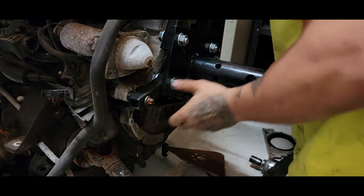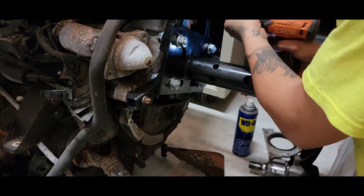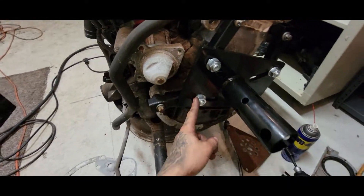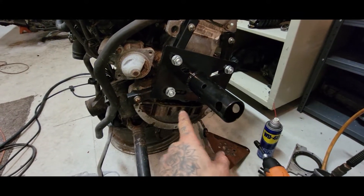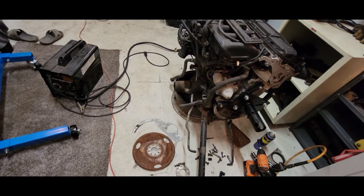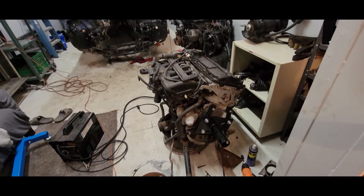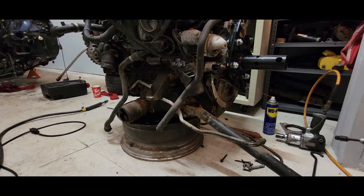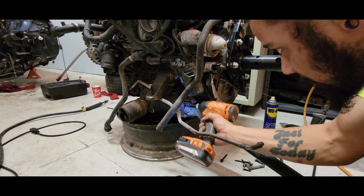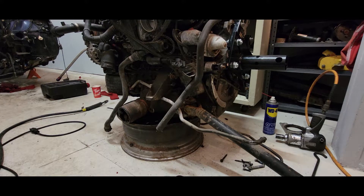This should work — and it fits on there, except those bottom ones. I might have to cut them just a little bit more or else I might be pulling the threads on those. So I'm going to cut the bottom ones just a little bit more. Now I just tightened down these bolts — the transmission bolts are on. That's been modified to be the way it needs to be. Now I'm going to get this thing on a cherry picker and get that drive shaft off. That's the only thing preventing me from getting this engine on the stand.